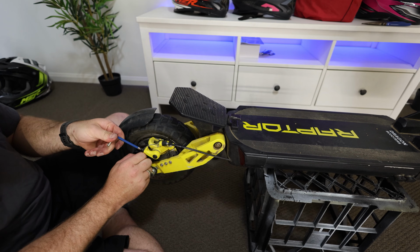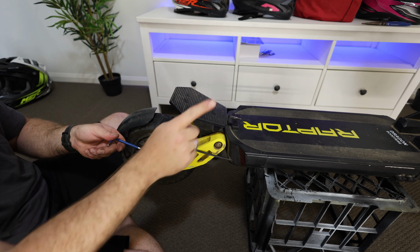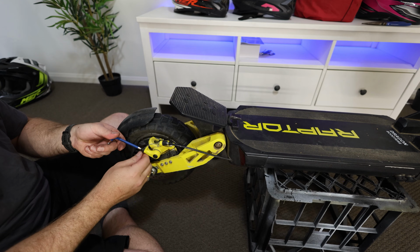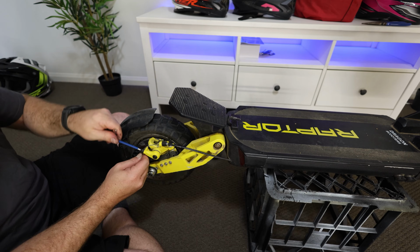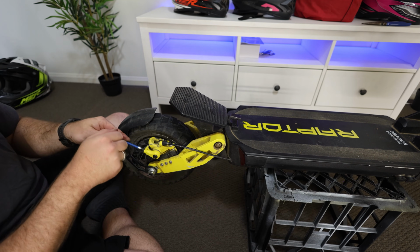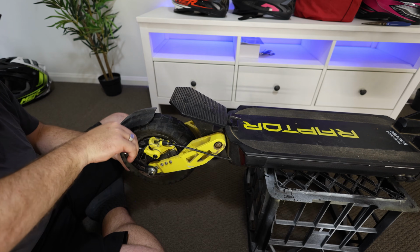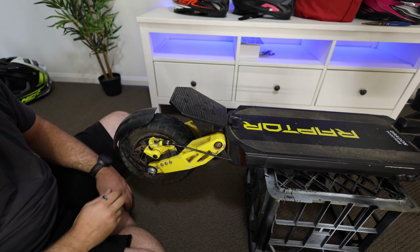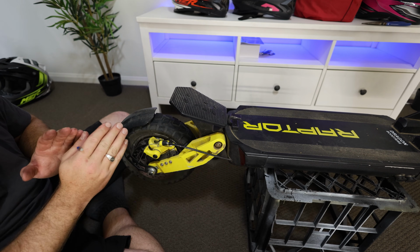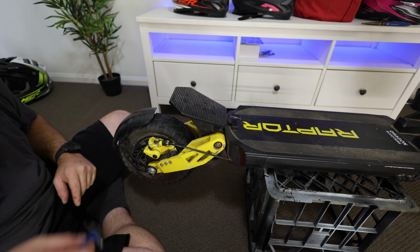And we just want to pull a little bit of slack off there, because any slack that's in the line that goes through the scooter, we just want to pull that out. This can also be used in the final adjustments for these little things, but for now, we want as much cable as possible. There you go. Now, everything on the rear brake has been wound back. You need to do this exact process on the front as well.